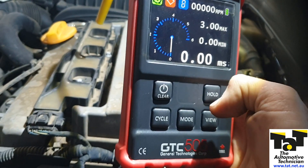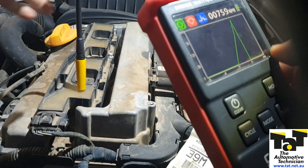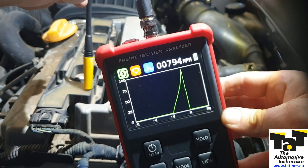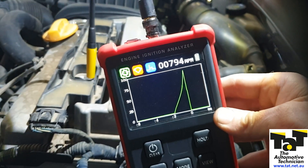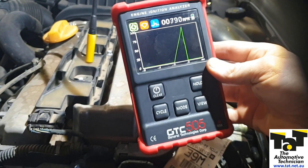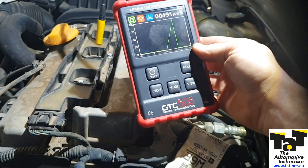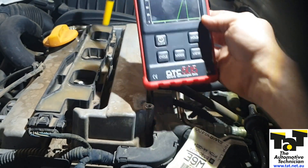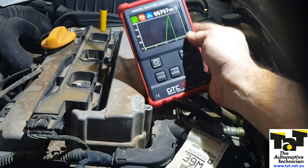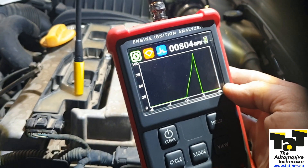Let's go to ramp time. This is just the same as going to the waveform — this is like if you were to put a current clamp around a coil. We've got our current ramp there. Again, we're going through and looking if they seem similar. We have a current ramp on all of them. There was a difference, I would say, on number four — you'll see how there's a little bit more of a slope.